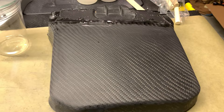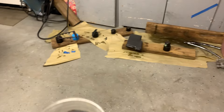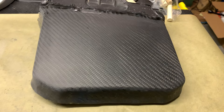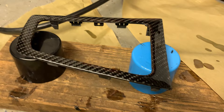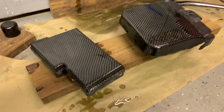All the parts are sanded and here is the battery box - you can see it almost looks like dry carbon just from the sanding. So even if you like this look you could just use 2000 grit sandpaper to get out any of the scratches and that could actually look pretty cool. But I want mine to be glossy, so I'm going to mix another cup of resin to finish all the parts. I'm just going to layer it on as thick as I can so that it can self-level, and hopefully I won't have to sand and polish this. They almost even look perfect now, but I've already seen just a little bit of dust specks in them.